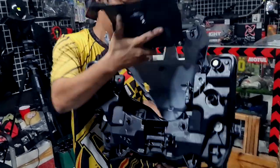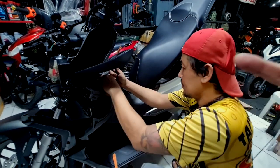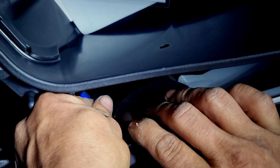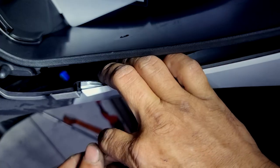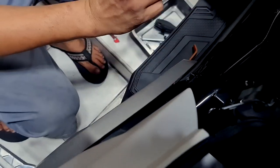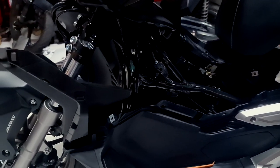That's the entire headlight removed from the ADV160. After removing the headlight, the next thing we have to remove is the gas tank cover, in order for us to start wiring the mini driving light. There are body pins connecting the gas tank cover and the side panel — two of them. Once the gas tank cover has been removed, we are now going to install our relay in order to begin installing the mini driving light.